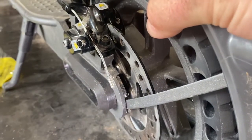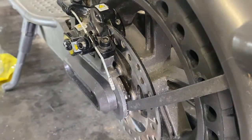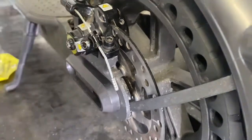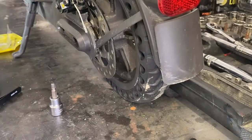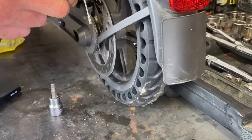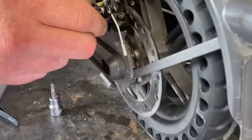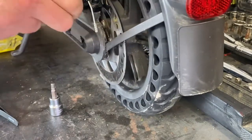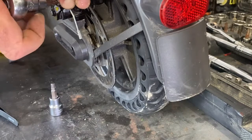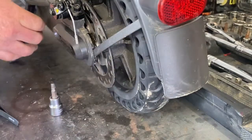Okay, that's us — just make sure that's tight. Then what we do is make the final adjustment on the brake itself. I'll roll the wheel back and forward to make sure that the wheel's turning freely, and I'll pull this up until I get to the point where there's a bit of resistance against it — and that's the point. Just there — that's where you want to be. Then we'll put the stand back down, get to that point, and tighten this up. Make sure this is fully home, otherwise it'll pop in and your brakes will be really loose.